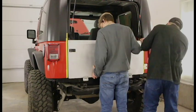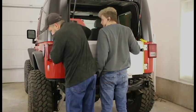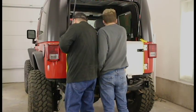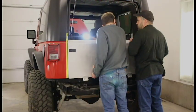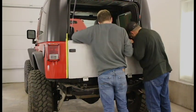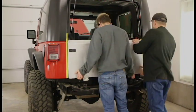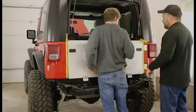So what we're doing right now is putting the tailgate on the Jeep to mock it up. So we're taking the latches, we're latching it where they would go so it'll stay on the Jeep, and we'll line up the body line, make sure it all fits, and then we'll take a Sharpie and mark the holes where the hinges will go. We'll drill the holes, and then we can mark the hinges up and make it fully functional. Everything is set and attached, ready to go, except for the hinges. So that's the whole point — we're trying to get the hinges done, and then it'll be fully functional, and then we'll take it all apart and paint it, and then put it back together.